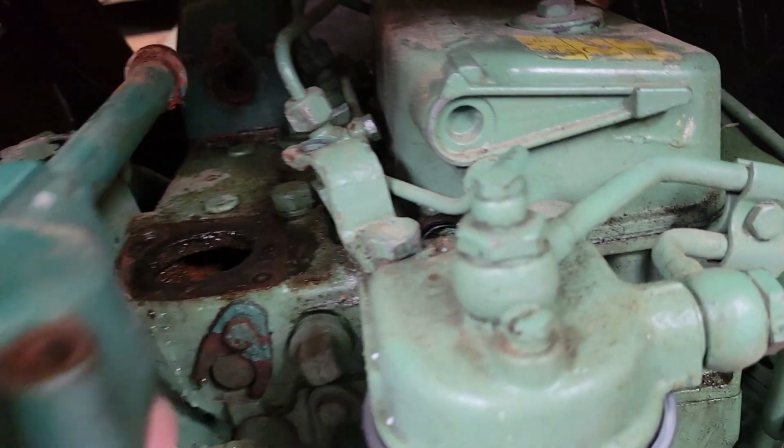This doesn't take that long. It takes longer to take the thermostat out, and often the hose loose from the through hull, than it does to actually run the fluid through the engine. Usually I run about 2 gallons of it through. I use the pink environmentally safe RV stuff, and that is plenty. So it's good for down to 50 below. So anyways, let me show you how you do it on this engine.